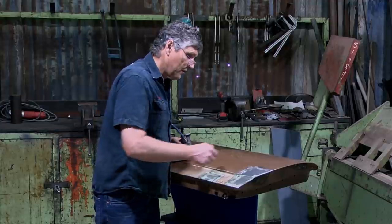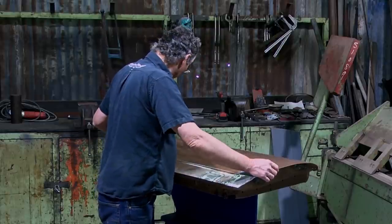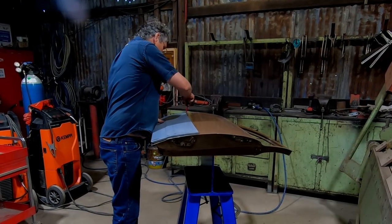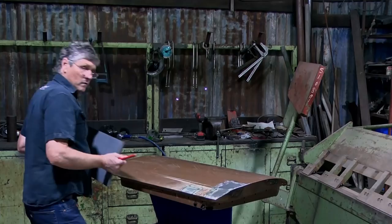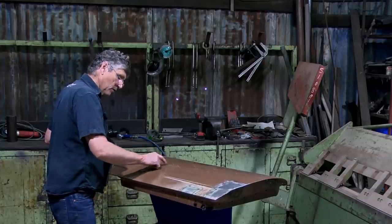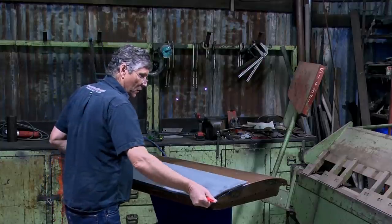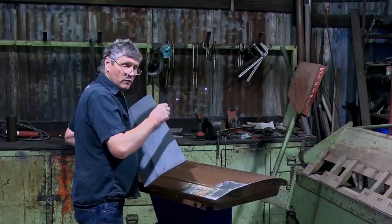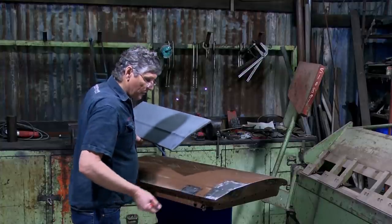So what we might do now is just cut this off through here. I've got a rough pencil line — I'll get a new one on there and we'll get rid of the skin and then get into these corners. I'm going to cut this probably three quarters of an inch, so 20mm or so below the line. I'll give myself a little bit of room there. When we're ready we'll line this panel up on the door, overlapping that piece of material, then get a nice scribe line all the way along the top edge and trim it back afterwards. For now we just want the material out of the way so we can get into the frame and sort that out.